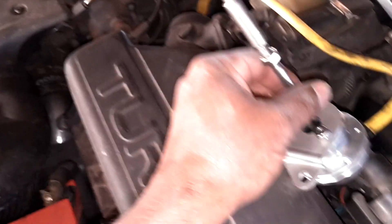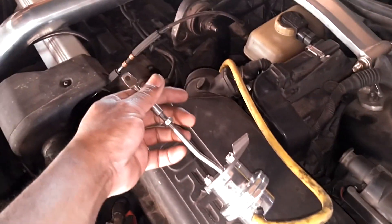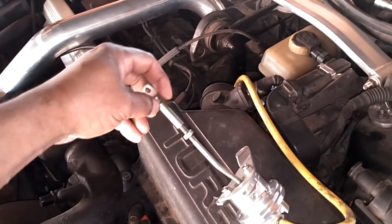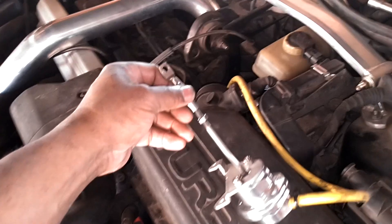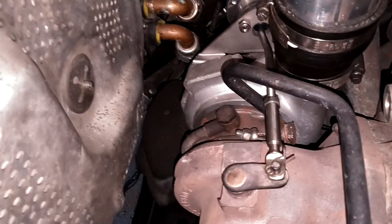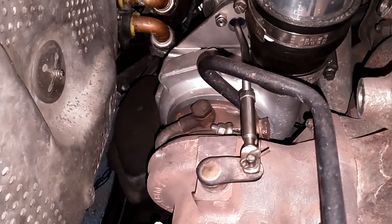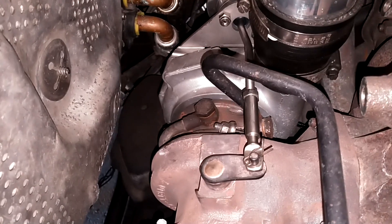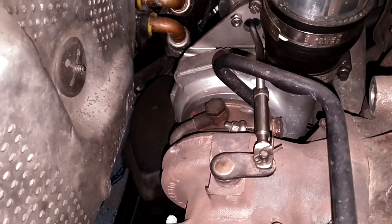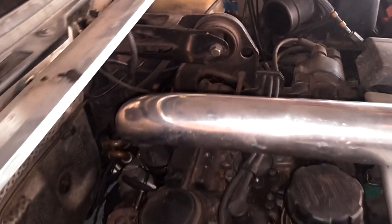It's best to do this stuff on a workbench. I twist this back on — I spun it down about 18 turns. Now I'm going to bolt this back on. Once I get this bolted on, I'm going to slip it over the closed wastegate actuator, then lift it back off, turn it in two complete turns, pull it out, and hook it over the wastegate actuator — that'll hold the wastegate closed until it needs boost. I adjusted the wastegate actuator, cranked it out until it slid over the closed wastegate rod, then cranked it back in two full turns and pulled it over the pin. I had to use a tool to pull it over the pin with that yellow spring in there, then stuck the set pin in. Now I'm going to put my intake tube back on and I'll be good to go.